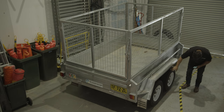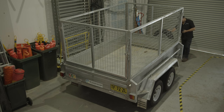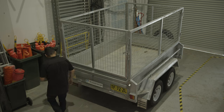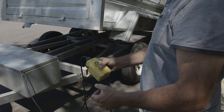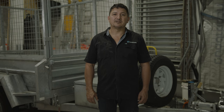The first thing to consider when using a trailer is the pre-start. A general walk around to check whether the tires are fully inflated, whether the spare has got air, whether the cage is damaged or free from snagging objects. Obvious items such as broken or frayed cables, damaged chains or damaged jockey wheels are all part of the pre-start checklist.